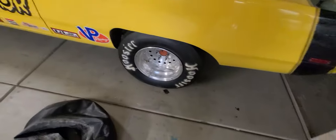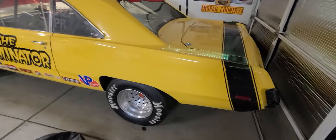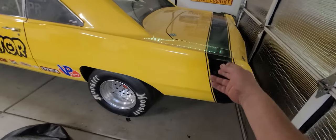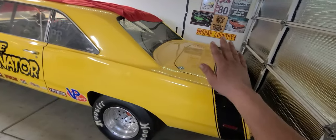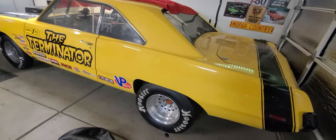So I'm going to keep going through this thing. After seeing this, I'm going to dig deeper because I am not going to take this thing out and have something go wrong — or suck a bunch of the foam that probably rotted out from sitting in Arizona sun that's inside that tank into the motor and blow that up. So I'm going to replace the tank. I'm going to replace the fuel system. I'm not playing around. We're going to do this right, and then we're going to go rip this thing.